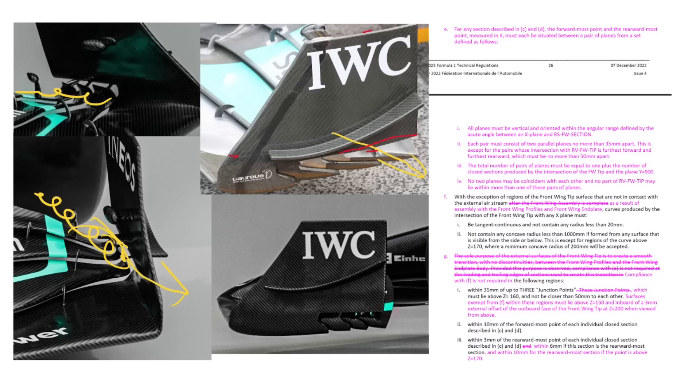On the old design we've cut out this whole section, whereas on the new design we've cut it out from here — and all the elements are quite backed off — so we're going to allow more mass flow through that region. We're going to largely achieve the intent of last year's geometry: more outwash through the cutout and a stronger vorticity along the corner.